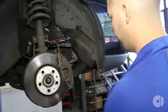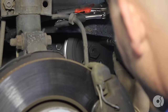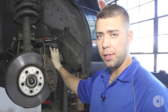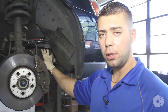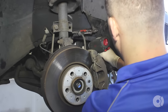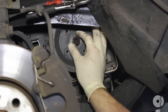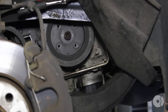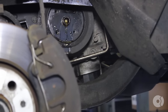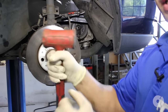We're going to go ahead and remove our crankshaft pulley now. There's going to be four 10-millimeter bolts and one 30-millimeter. Once you take this nut off, it's going to put pressure on the crank and may turn it just a slight bit. Once you get it off, make sure your marks are still aligned properly. Because this has been on there so long, you might get some corrosion. I like to use a penetrating oil — let it soak for a bit. You can use a rubber mallet to slightly tap the pulley and slowly walk it off.